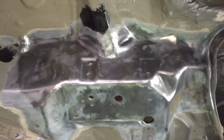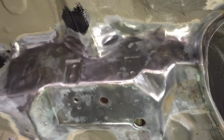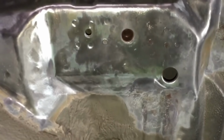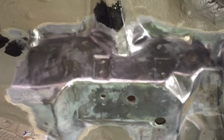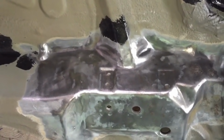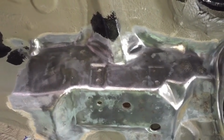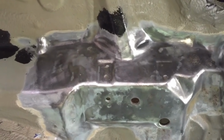And on these mounts, where they especially get quite heavily corroded and pitted, especially under the bottom, we've had a POR-15 metal prep solution on there, which is what goes on before the rust preventative paint, and that neutralizes corrosion, tries to draw it out of the grain of the metal, especially in heavily pitted areas, and also etches the floor.